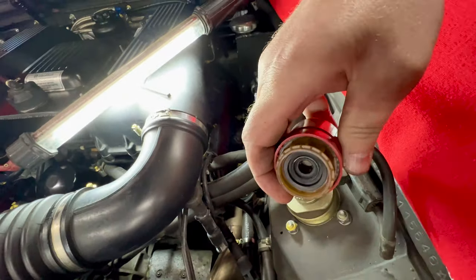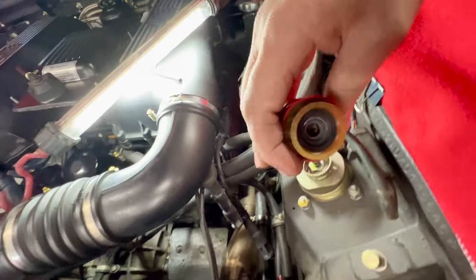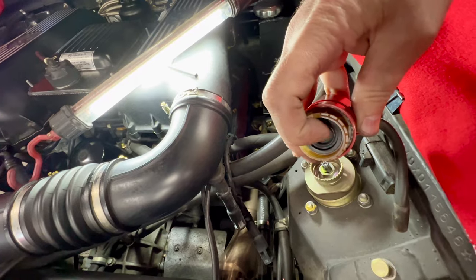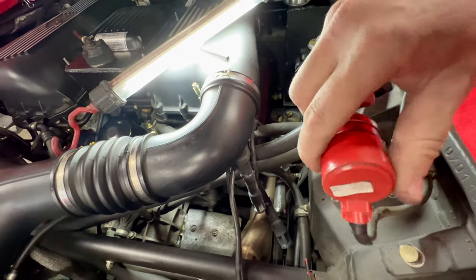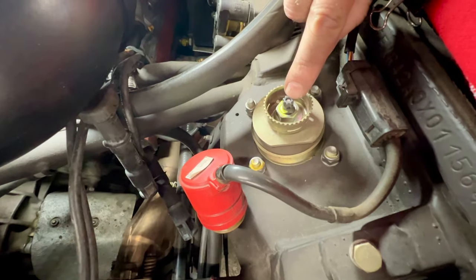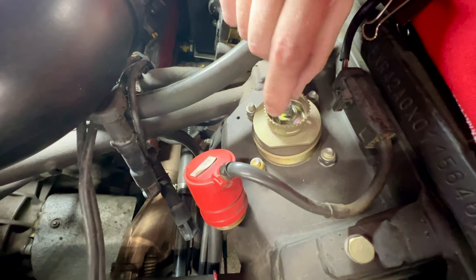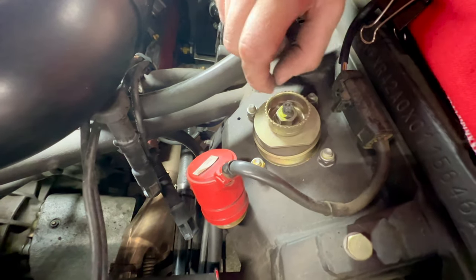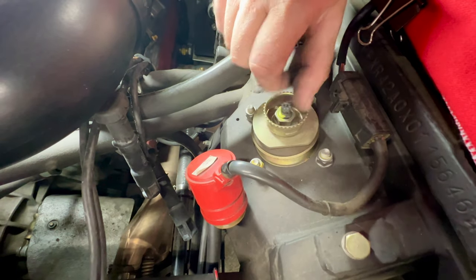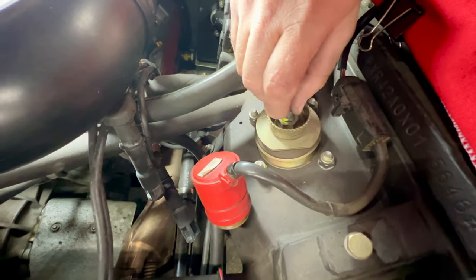So you want to look inside and you can see where it's all splined and goes onto the shock. It will be loose in there, which is normal, but you want to be sure that that plastic piece isn't cracked anywhere. That's a common problem on these. If it's cracked, you need a new actuator. Down on the shock, what you want to pay attention to is this gear up on top of it. Those will crack as well, and you can replace those with just a little dowel pin or roll pin that goes through them. So we're making sure that that's good, and this one is good. And you can see that these just rotate and have end stops on the shock. It's all the way over on the end stop there and all the way over on the end stop there.